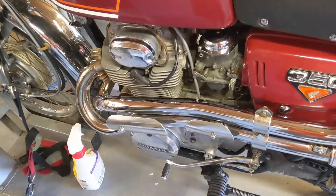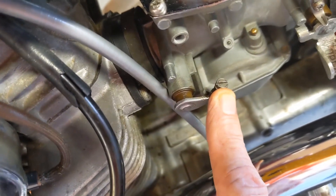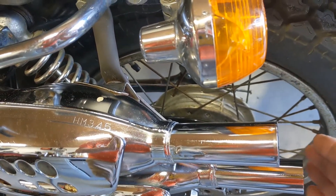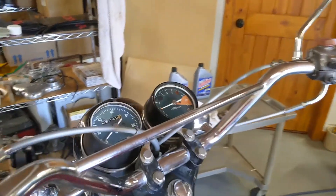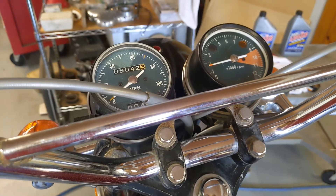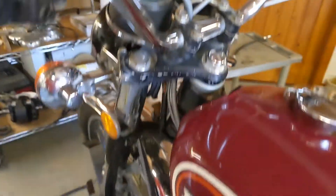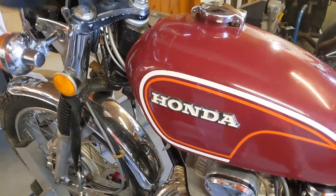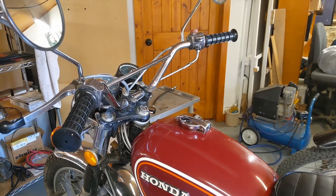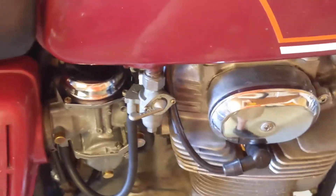If you need to adjust the idle, there's only one screw on each carburetor — you'll figure it out pretty quickly by following the exhaust path. Both carburetors feel really pretty good and even right now. I'm pretty happy with this idle — it's a little on the fast side but that's okay; this engine hasn't been run in years and low idles are bad for them. Get in the habit of turning it off at the ignition key so you don't accidentally leave the ignition on and run the battery down.